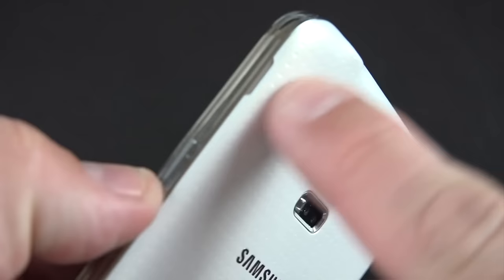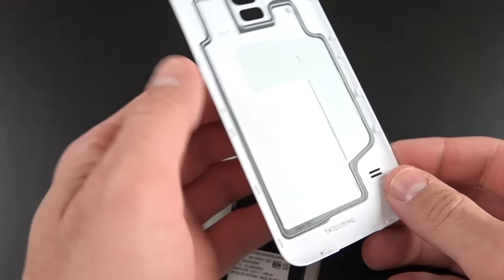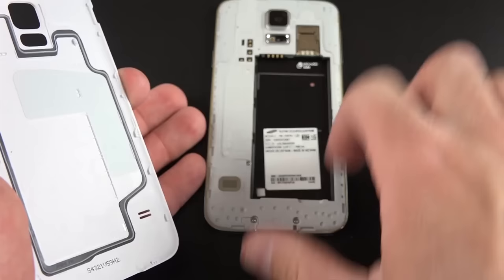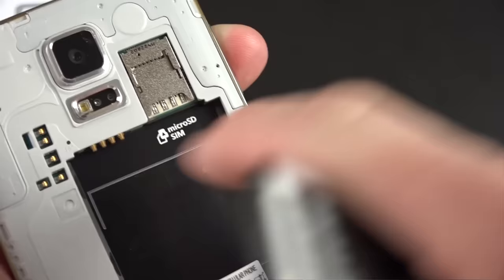The first thing I want to do is install our battery. I'm going to use this thumbnail port for popping off the back panel. If you look at the inside of the battery cover, you'll see part of that IP67 certification — the seal that goes around the internals of the chassis. It seals in the battery as well as other sensitive parts you don't want exposed to water. We have our combination micro SD and SIM slot; this is a micro SIM, not a nano SIM.